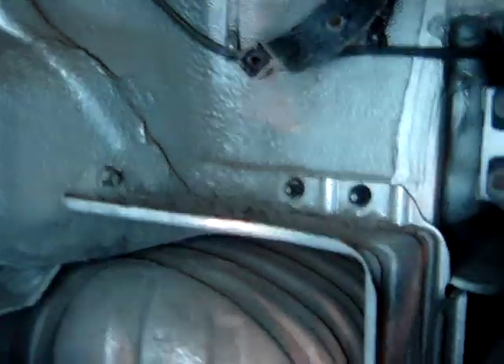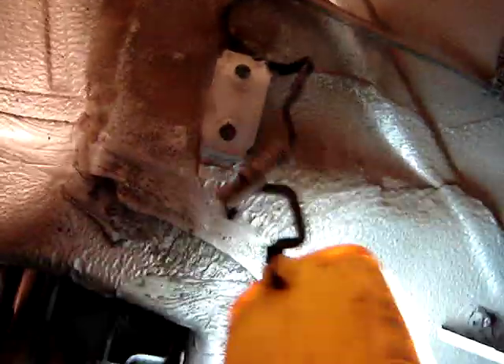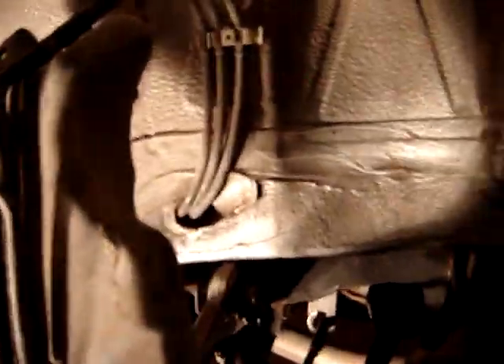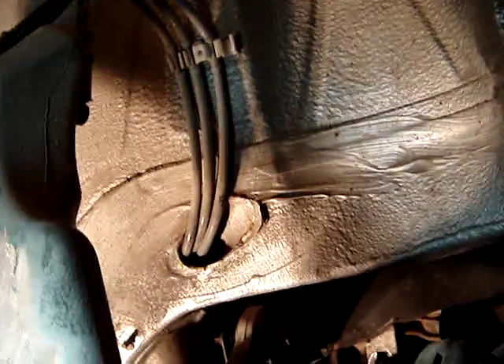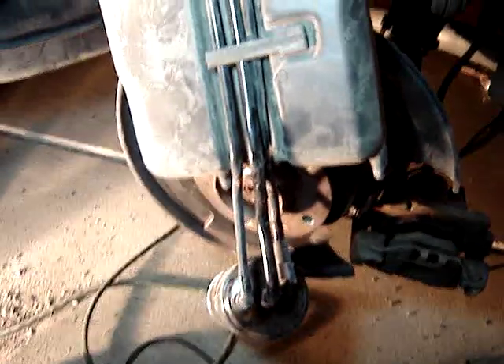Here's where the vent tube came from. I'll give the ABS wiring harness a quick look to make sure everything looks okay, then mount the charcoal canister back into place. I'll brush out this dirt and clean off the expansion tank and canister. Everything looks good — let me start bolting it back together.